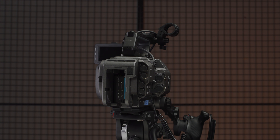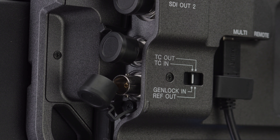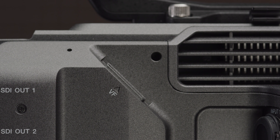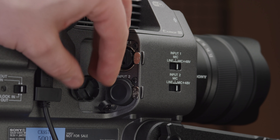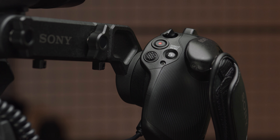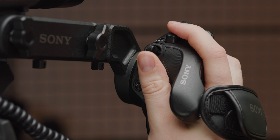On the right side of the camera you have a bunch of inputs and outputs: two SDI outputs, a timecode in and out, genlock in and ref out, and HDMI out. The addition of timecode and genlock on the camera body itself without needing to add on the XTCA will be a welcomed addition by so many people. You then have your viewfinder connection port, two XLR inputs with controls, and your standard rosette for attaching the arm and grip that come in the box. The grip has seen a few ergonomic changes and after using it, it does feel nicer. It also now uses Sony's multi-connection instead of the old remote type, which is much faster — you can feel the difference when zooming, especially with the 28-135 servo lens.